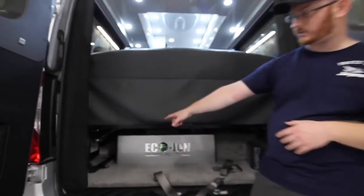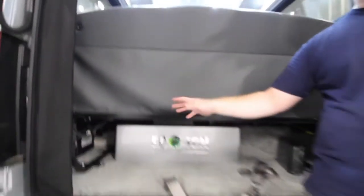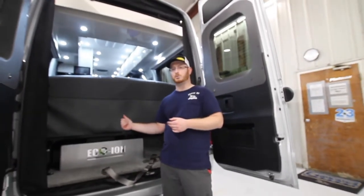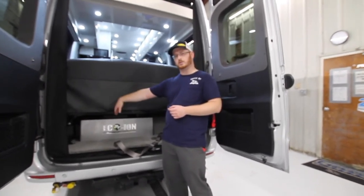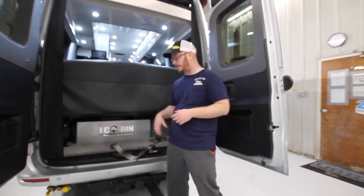On the left-hand side, we have our transfer box. What that transfer box does is it goes from shore power to the system when you're plugged into shore power. When you unplug from shore power and turn on your generator, it will switch automatically to generator power — there will be a slight delay before it engages.